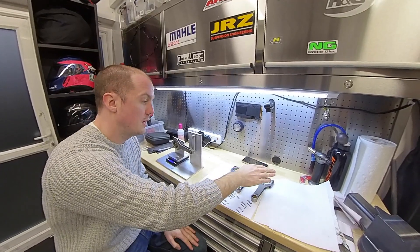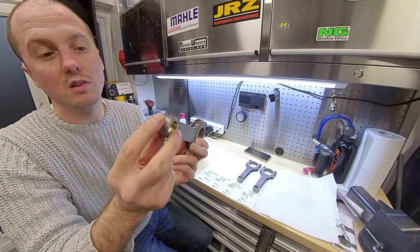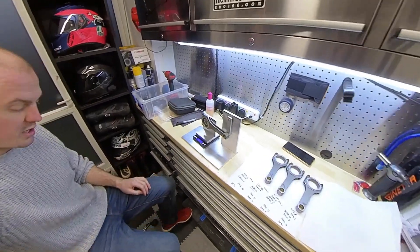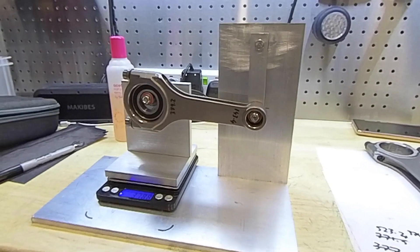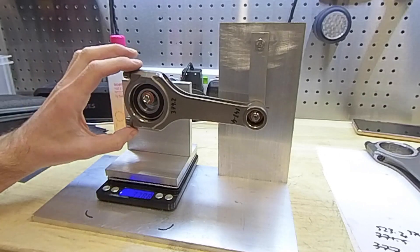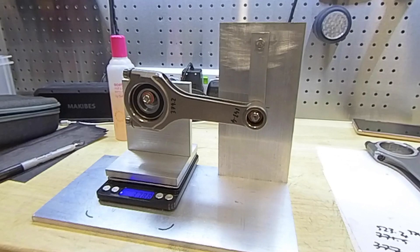That's quite a lot of material to remove, so I'm going to get on and do that. A few hours later, all of the conrods have been weighed and material has been removed from each one — you can see here on the big ends and there on the small ends. They now all weigh the same across the small ends, the big ends, and as complete units. I've also made a few improvements to the weighing mechanism — there's an extra wheel bearing, I think off an R6, which helps with resistance at the friction point where the conrod and cap meet, stopping it from binding and giving a true weight. All four rods are done, all the same weight.